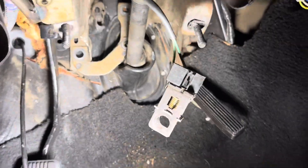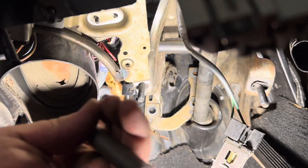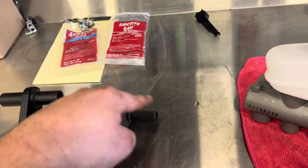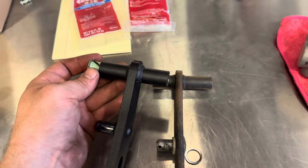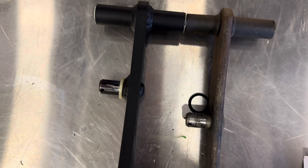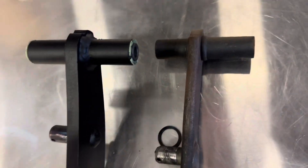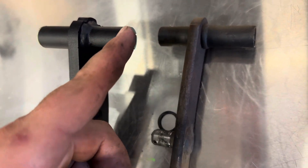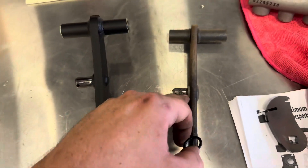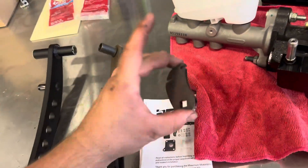Status update — there is no brake pedal. I did have to undo that top bolt so it would swing down, but I got it out. I'm going to take this over to compare against the Maximum Motorsports pedal. When you take the factory one off, there's an insert that comes out of inside the tube and you have to transfer it to your new one — just make sure it goes in the same way it came out. The stud does get moved up just a little bit to accommodate for the hydro boost being up a bit higher, but other than that it's pretty much identical.